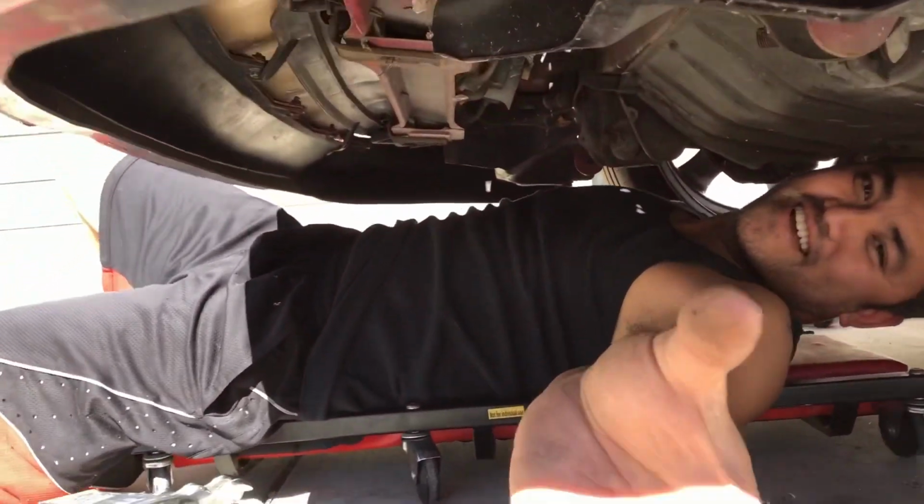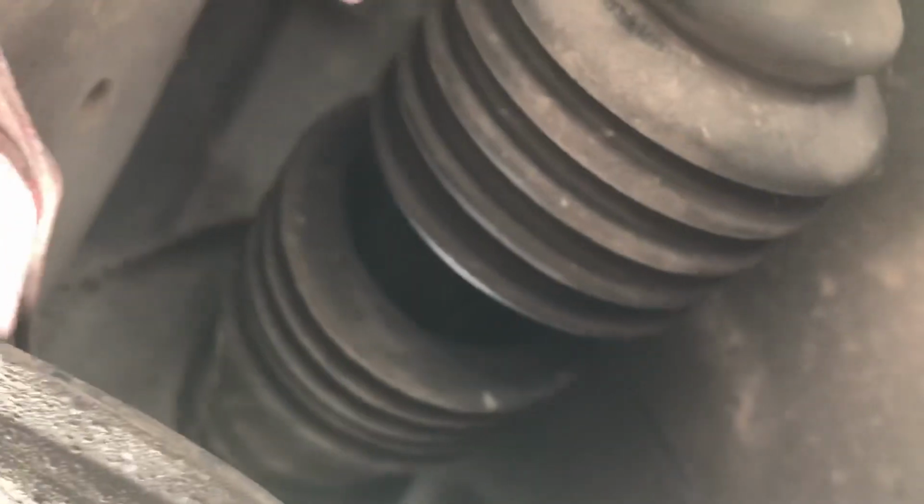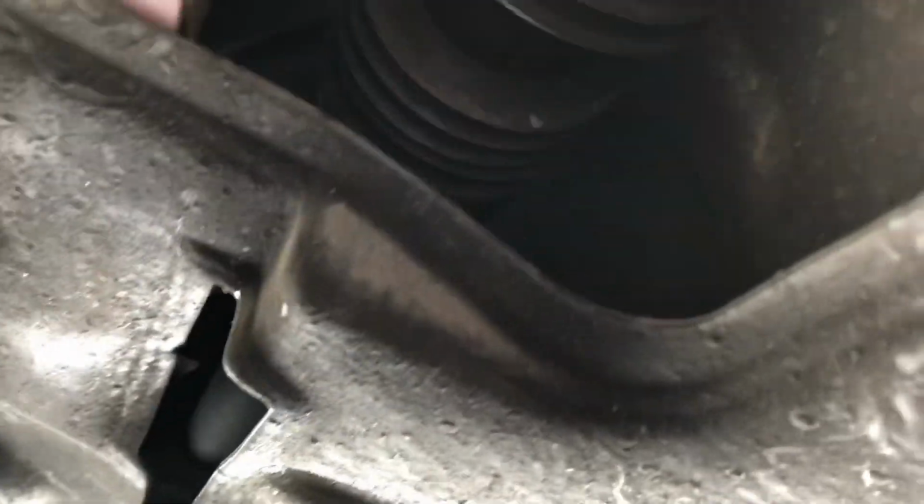Here, I'll show you guys. Okay. Thanks, honey. You good? Yes. All right, so here, it's a little hard to film, but this is a gap in between the rack, and when you grab the rack, you grab the wheel and you see that? That's that noise. And I don't know how bad that is to drive on, but that's the situation we're looking at.